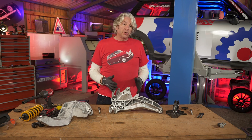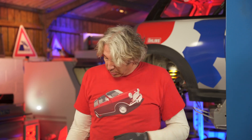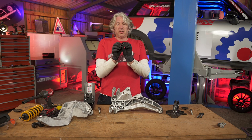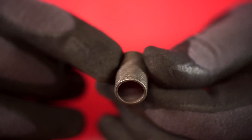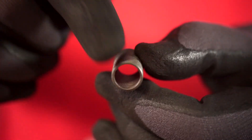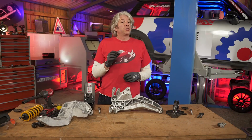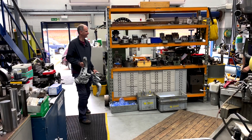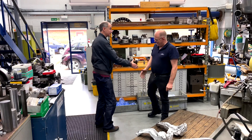So we needed a solution. I wanted to go for something a little bit stronger than one of these coils, so I went with a TimeSert. You can see this is like a solid cylinder of thread - it goes on both the inside and the outside. The thread on the inside is for the bolt we actually originally wanted, and then the thread on the outside winds in to the aluminium. It's quite an interesting process, and because I was so busy not blowing up a Range Rover, I sent Neil down to my mate Steve, who's a precision engineer, to actually get the job done on one of these nice big machines.